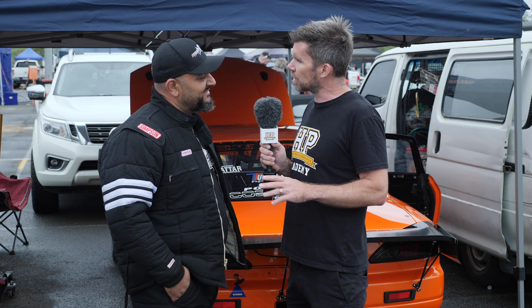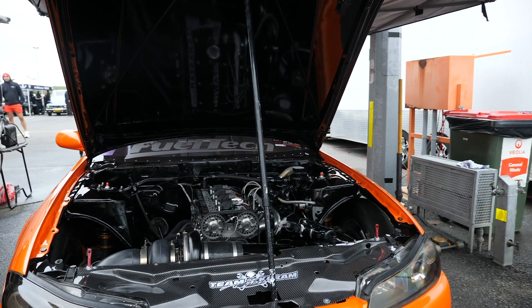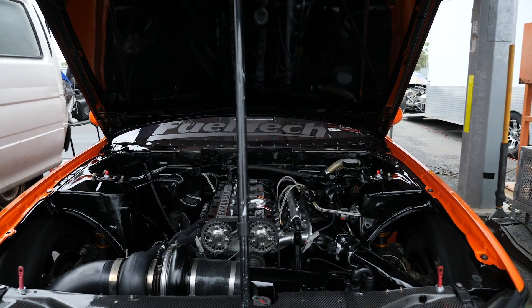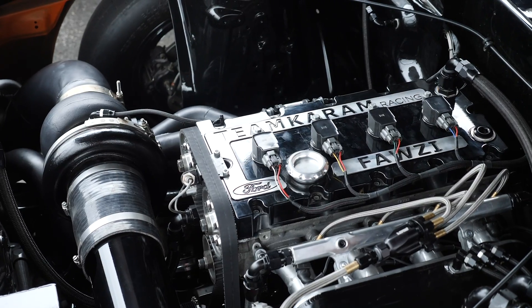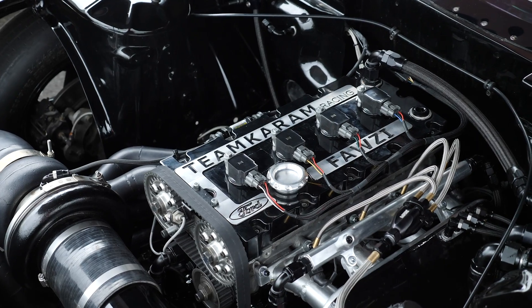You mentioned back pressure — this is something more often monitored in drag racing applications. You're talking about monitoring the relationship between boost pressure in the inlet manifold and exhaust pressure pre-turbocharger. It's a balancing act: more back pressure means more energy to drive the turbo but also less power. So for a drag application, where do you like to see that relationship? You need to be one to one, 1.2 to one. Any more than that and you're starting to choke yourself. For context, it's quite common in a factory turbocharged car to see exhaust pressure double or even higher than boost pressure.